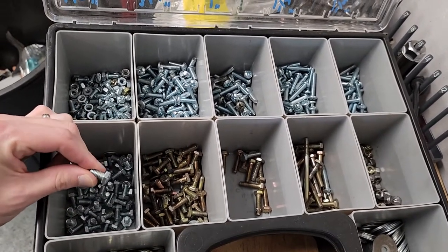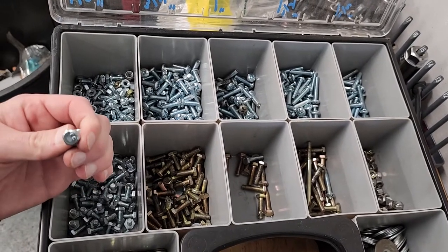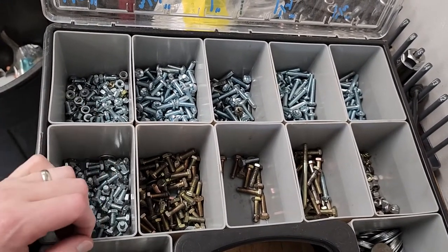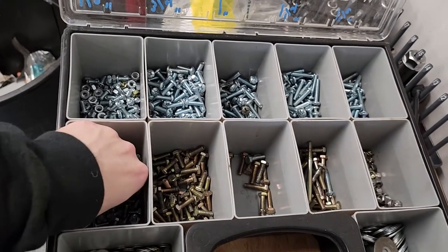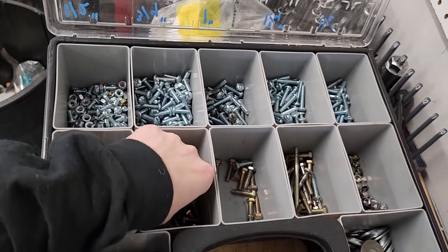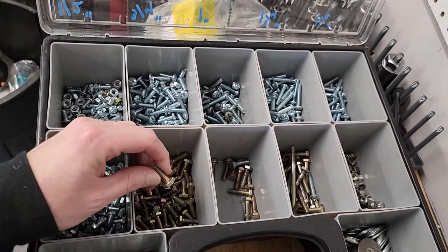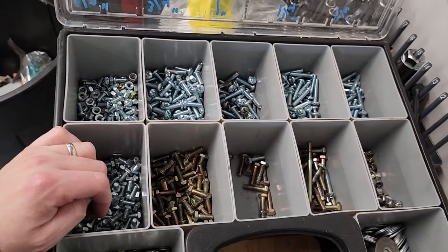And then we attach things to the frame using these grade 2 bolts, grade 2 or grade 5, probably grade 2, with the idea that if it gets caught on something or something occurs, this is going to shear first and this will rip off, and it won't rip off our subframe type attachments for the aero structure. So you kind of do that strategically.